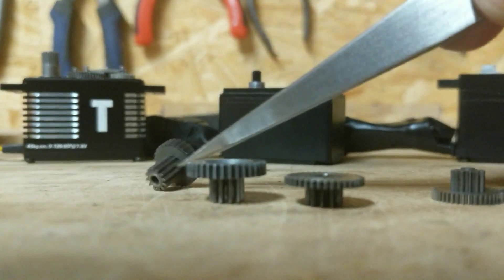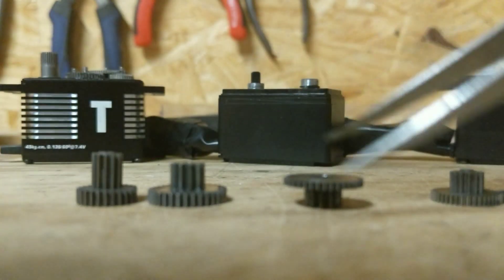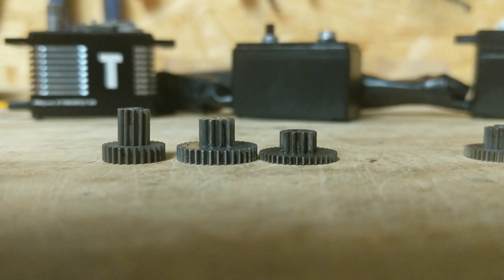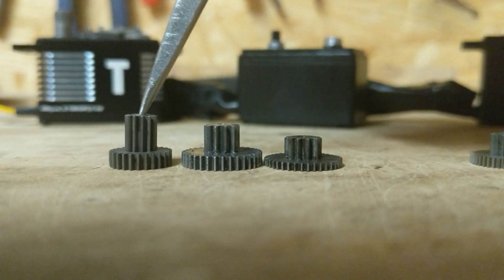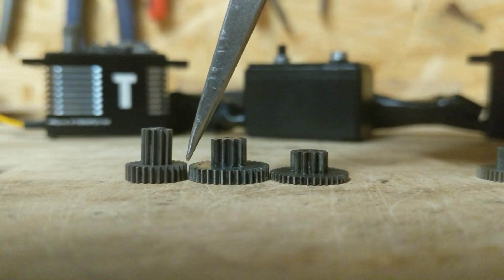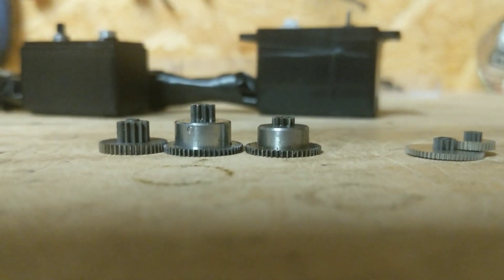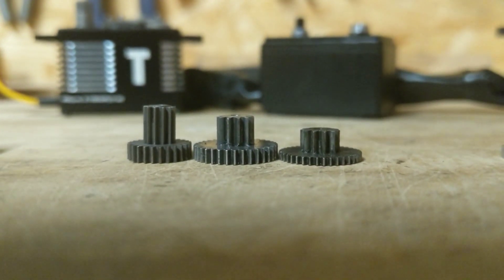You can see that even the third reduction on this one — even though it doesn't have to fight the shear strength and deflection of the pin — it's still a thicker gear on your third reduction. On the Model T that's the fourth reduction, but the third for these. Working backwards through the reductions, the Model T consistently shows thicker gears.